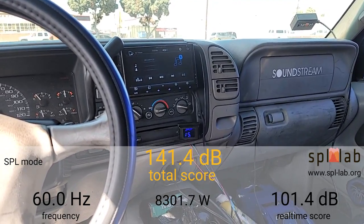As far as power out of this 15K, I did not see rated power, but at 1 ohm depending on the frequency, I'm pretty sure I have impedance rise. I do have to calculate what kind of rise I get at the different frequencies, but if anything is close to 2 ohms, then the numbers clamped today will make sense — because this amplifier does about 8,000 to 9,000 watts at 2 ohms and makes the rest of its power at 1 ohm. So even though I'm at 1 ohm nominal, with rise I could be at 2 ohms or higher. With that being said, I'm pretty sure that amplifier is accurately rated. Let me know what you guys think. I will have the FDZ Audio Depth Series 3.5K afterwards and we're going to see what kind of power we can get out of that. Stay tuned for more — as always, peace and love, thanks for watching.